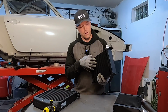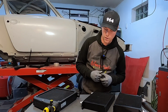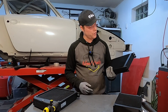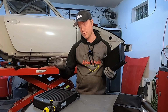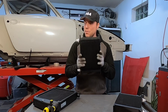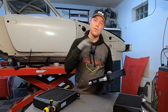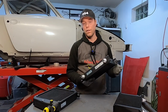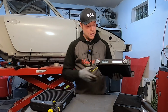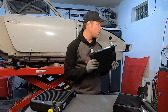Okay, and here is another alternative. So this is a Setrab 625. As I was calculating the heat capacity, looking at different cooler alternatives, I found that this could be an alternative. It has the same approximate cooling length as the original cooler. However, this one has 25 channels as compared to 22 channels, meaning that there is more surface area here between the air and the oil. However, the envelope is a little bit smaller, meaning that we have to push the air a little bit harder to get through this one than we do with that one. On the other hand, this one has more area. So with good efficient inflow, this one gives us more. And you know what? It's roughly half the weight. I don't know if this is the best alternative yet. Let's see if there is a symmetric, nice, lightweight alternative of fitting this one to the car.